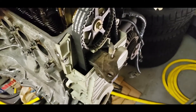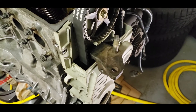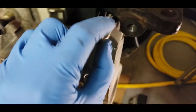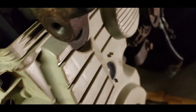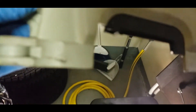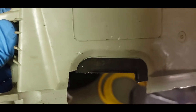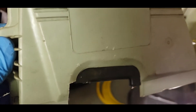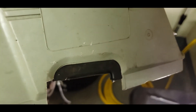I got the engine mount bracket on, torqued it down to 40 foot-pounds as per the manual. I had to modify the timing belt cover - trimmed it a little bit here for clearance when you try to tuck it in. The top cover needed to be trimmed as well. I just cut it pretty easily with an X-Acto blade and now it fits perfectly. That's all for today - stay tuned for the next video.